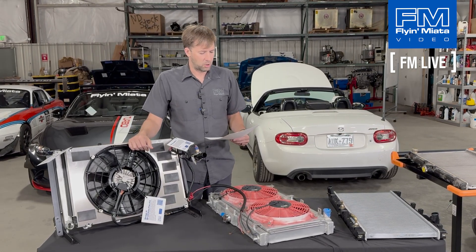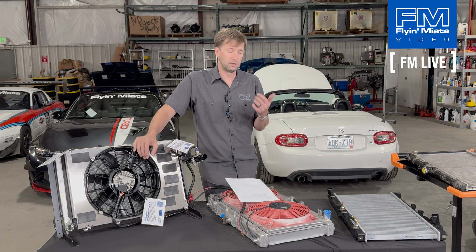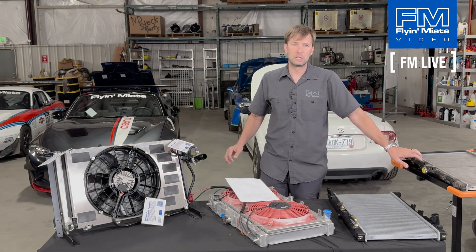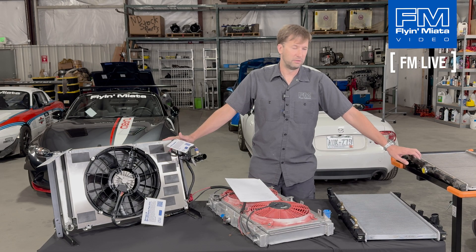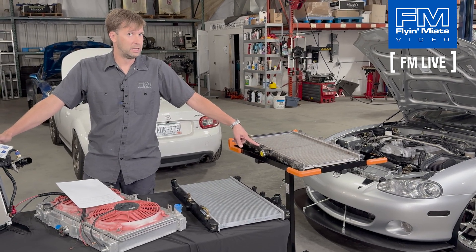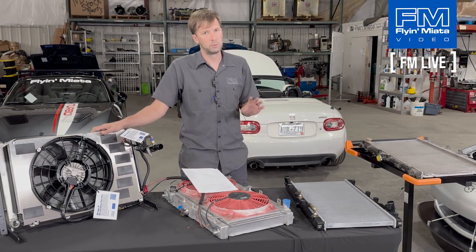If I have no issues at the moment, when would I actually need to upgrade my radiator? You want to upgrade if you're having overheating issues or if you're going to have more power in the future — more power equals more heat. You can postpone that for the future from a power standpoint, but make sure you check your radiator. We see a lot of stockish Miatas with very discolored end tanks. If the plastic is not a deep black — if it's gone brown, and especially if it's green, that's real bad — the lighter the color, the closer it is to outright failure. The plastic gets brittle and will snap off, so be very proactive about this.